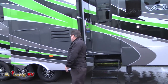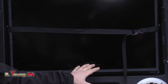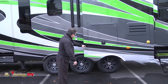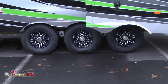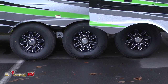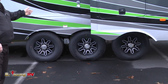On the outside passenger slide, it is equipped with an outside entertainment center. Inside you have a 30-inch TV with two outside marine-styled speakers that are protected from the elements if they do get wet. Underneath, you'll notice it has three axles — each are 7,000-pound rated Dexter axles. The wheels are alloy rims; they're slotted to pull air in to cool the oversized brakes and also designed to dissipate heat, as steel rims collect heat and deteriorate the tire sidewall much faster.